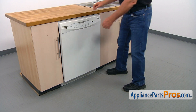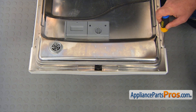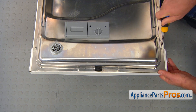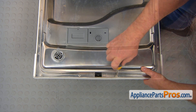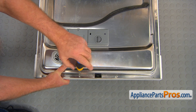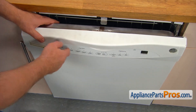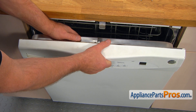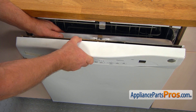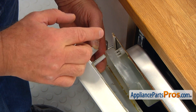To get to the part, we need to open the door. We are going to remove three screws on each side and take off the control panel. I'm using a Phillips screwdriver. Hold on to the control panel when you're taking out the last screw. Let's close the door partially and then we're going to pull up and out. Be careful not to break this mounting pin when you pull out the control panel and put it back in.